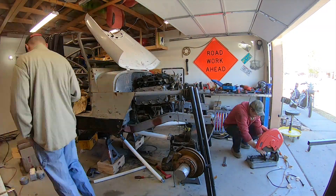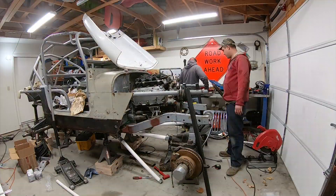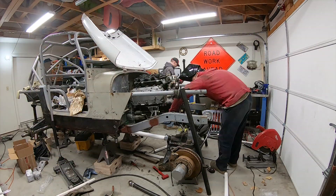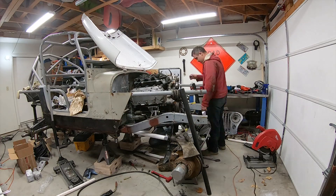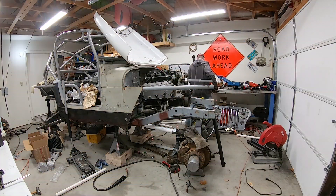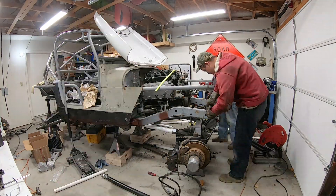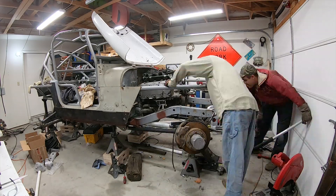As for triangulation, we ended up getting about 30 degrees on the uppers and another 10 degrees on the lowers. I was shooting for 40 total and I'm fairly happy with that. We cycled the suspension up and down and tried to move the axle side to side — we were unable to. There's no side-to-side play, so I'm fairly convinced it's going to locate itself as it needs to.